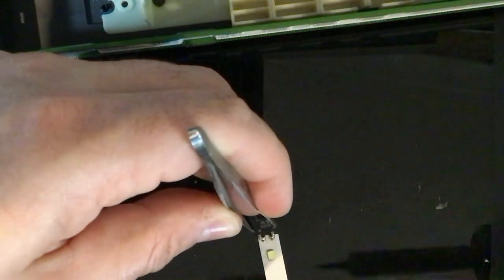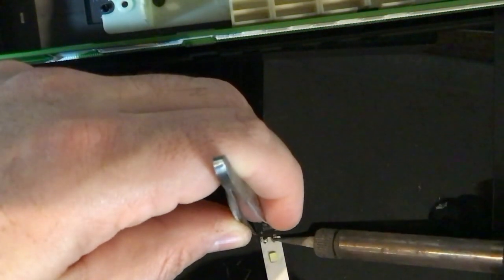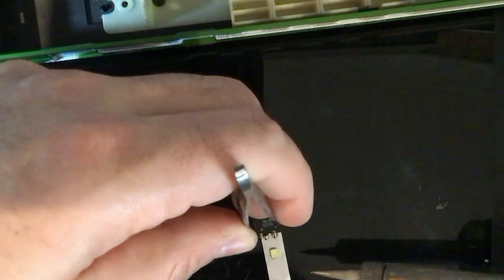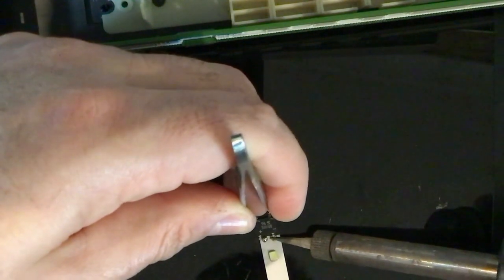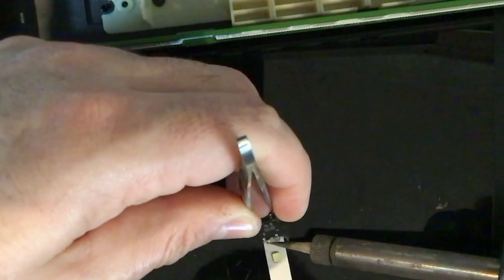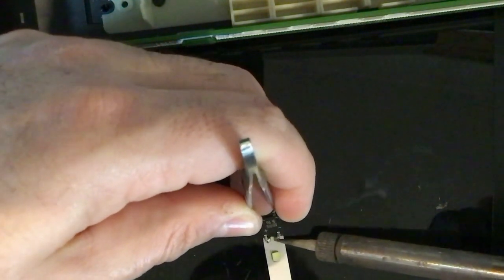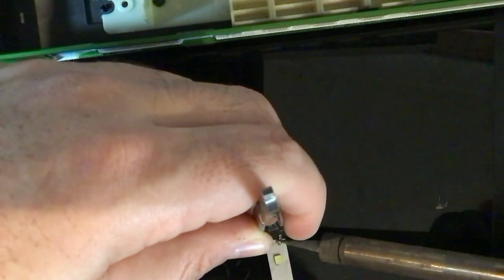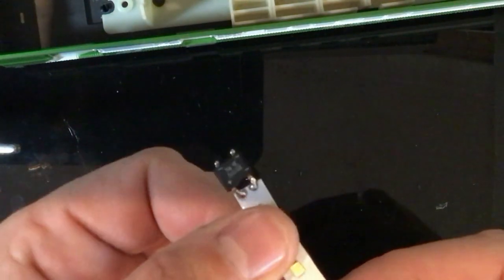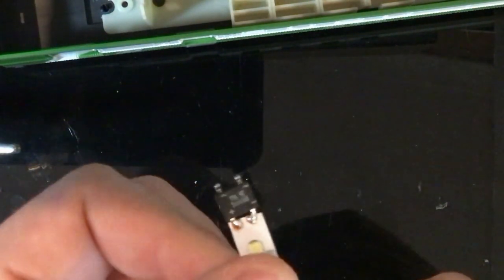Pop them in place. It's in but it's too far to one side, so I'll unsolder it for a second and reposition it so I can catch both on the tab - the pins don't 100% line up with the LED strip. Make sure that it's a good contact. Let's do the capacitor side - the capacitor side is a little bit more tricky.